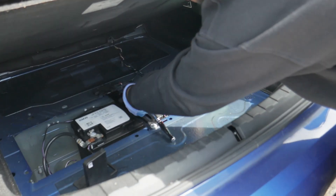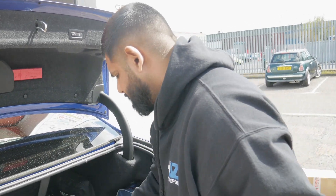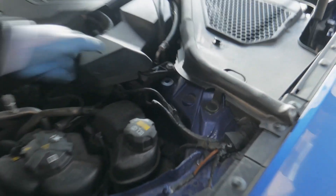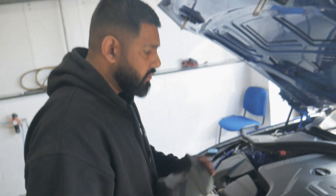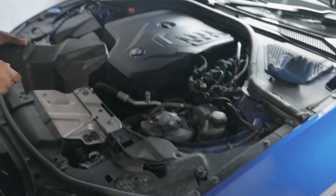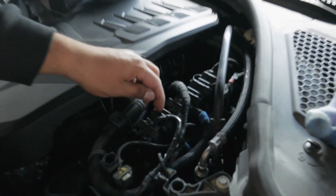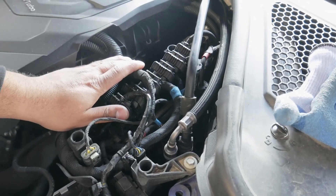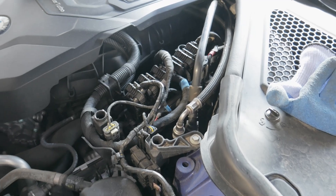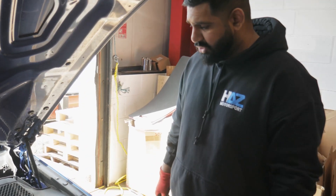We're just going to remove the battery. Battery disconnected. The ECU location on these is pretty decent — it's right there. We just pull this ECU fuse cover off. We've actually got carbon engine covers and carbon fuse covers for these cars, which is a great little thing. You can see these are the ECU lock tabs — if we unplug these they should just pull out, but we're going to plug directly into it from the car. There's no point pulling out the ECU, so we'll pull a few of these tabs off and pin into it on this MG1 ECU.